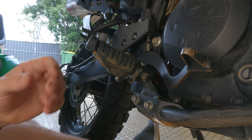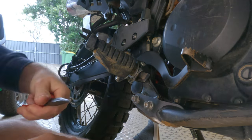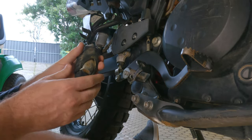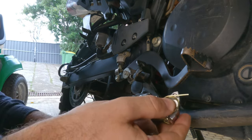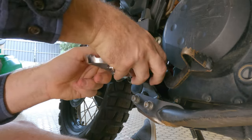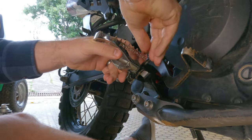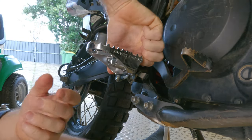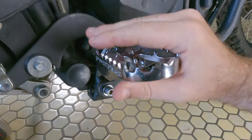This side is going to be the exact same process. This side is worse than the other side — look at this, it's so floppy and disgusting. We're going to get that off and throw it in the bin. Circlip off. Some sand in that one — look at it come out. Do better Kawasaki. You can see it comes with a little rubber band showing how it's meant to go. Pop that off. Put it like that, push in, keep pushing until you get through, and then get that bottom bit square. There you go, all done. Put that circlip on.